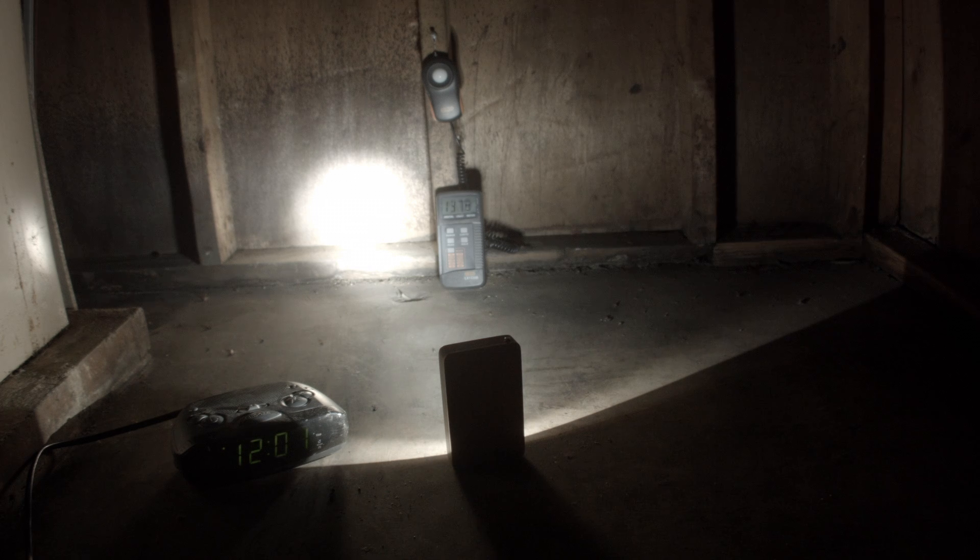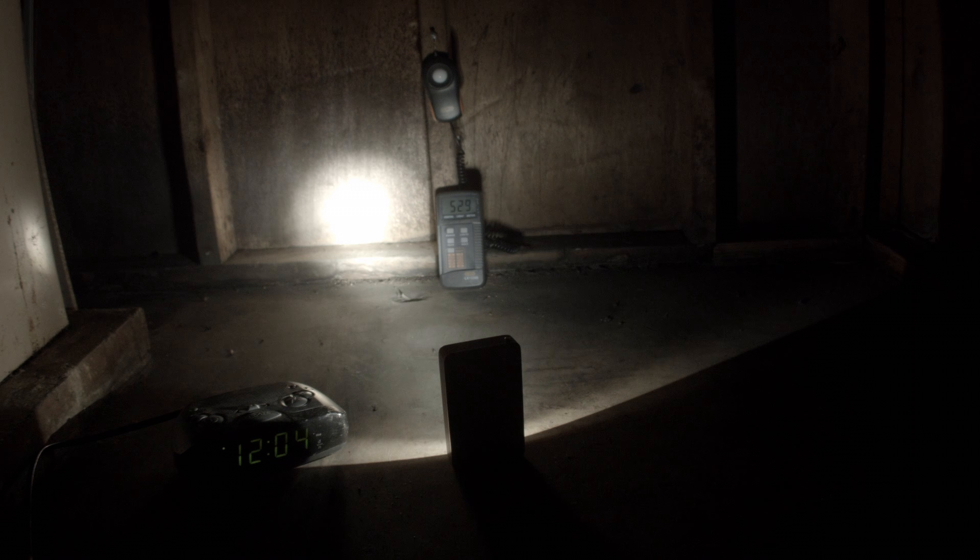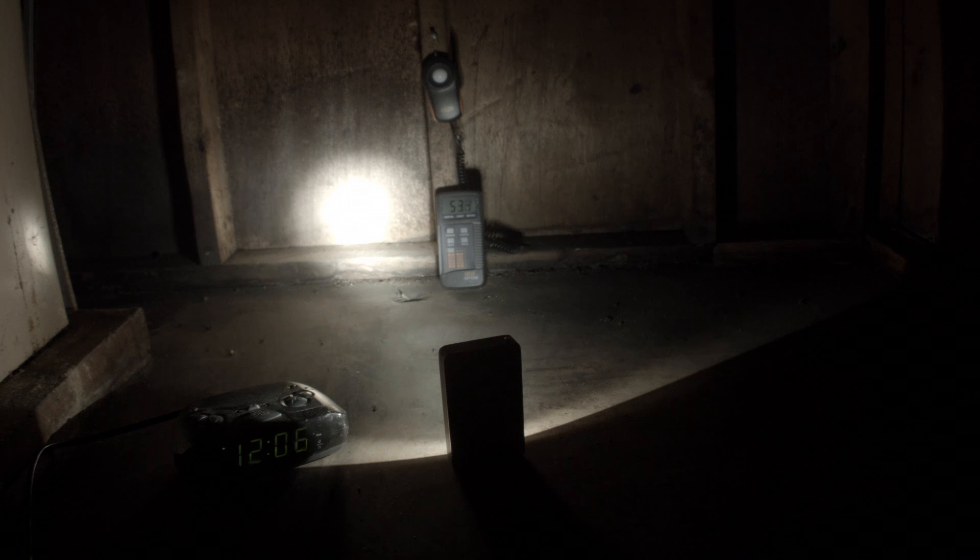High: via the firmware I set high to a temperature I felt was comfortable to hold. Different ambient temperatures affect how long before it steps down — if your room is 80 degrees it'll step down quicker. A step-down is a hard cut in brightness. At about 4 minutes in, total output cuts in half. Per ANSI/FL1 standards, the flashlight is rated at about 30 seconds in — my reading was 144 lux at that point. The light holds brightness steady after the first step-down until about 48 minutes, then dims and cuts off at 49 minutes.